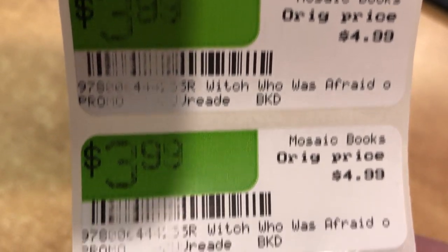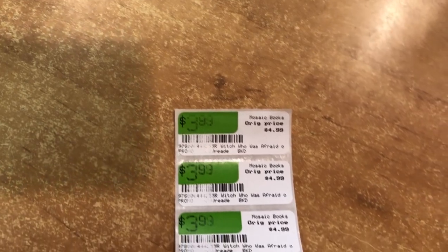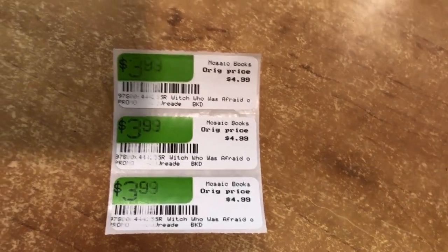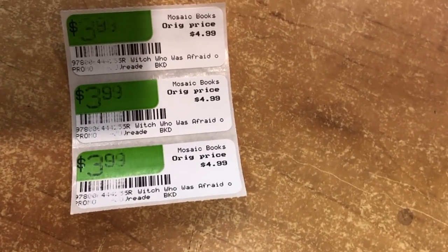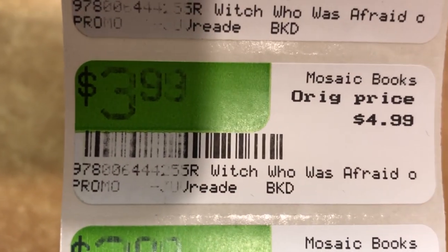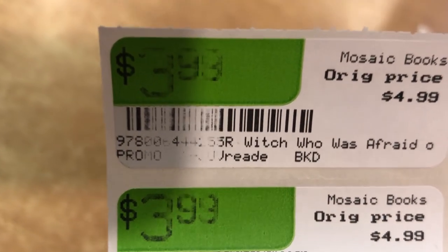What I figured is it's probably some sort of buildup on the print head. Whether you use green labels or not, over time you may get some buildup on the print head which prevents it from making solid heat contact with the label — and therefore you get faded printing, to the point where barcodes may not even scan.